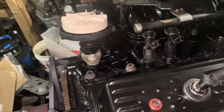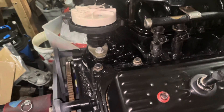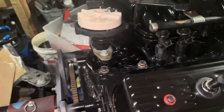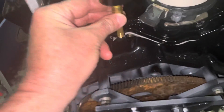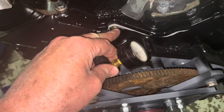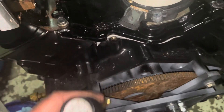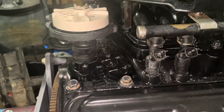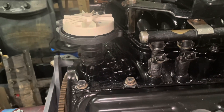The distributor is now in. The next thing I want to do is spin the engine over with the starter again and see if I can get oil pressure by turning the oil pump with the distributor, as if it were running. However, my oil pressure gauge won't fit in the hole because it's hitting the body of the distributor, so I'm going to need a 45-degree fitting to turn the gauge out so I can read it. I'll have to do that tomorrow. I hope this made sense — thanks for watching, and subscribe to my channel if you haven't already.